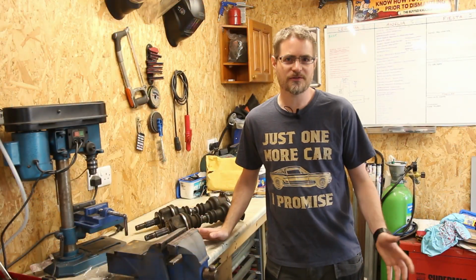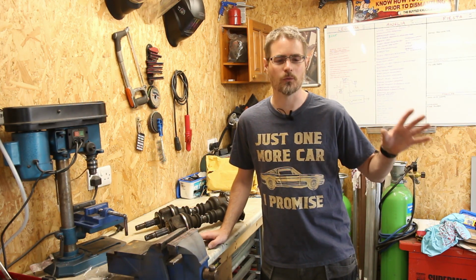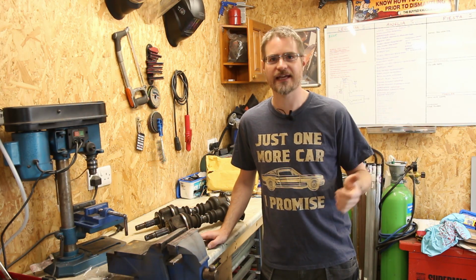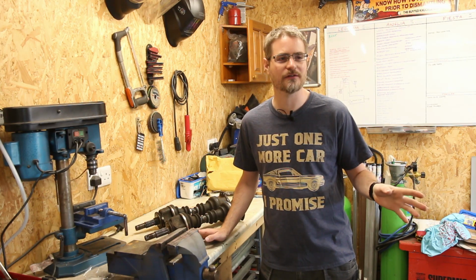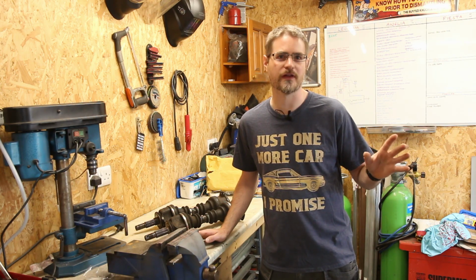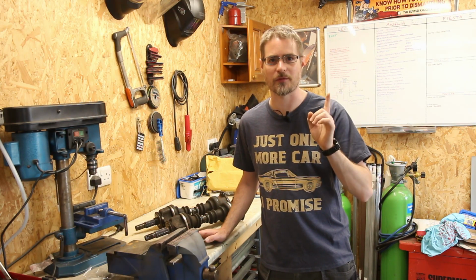At the beginning of last episode I was really worried that the engine in the Anglia was dead, but after sticking it up in the air, the engine doesn't seem to be dead. A little bit of noise coming from the front, maybe one of the pulleys for the cam belt, but the main issue with it at the moment seems to be the big vibration coming from the back.